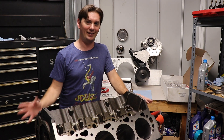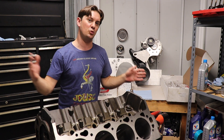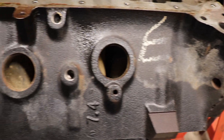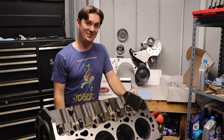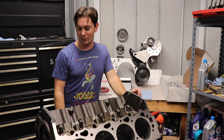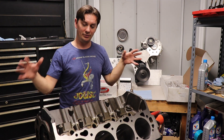I don't know what everyone pays for machining in other states, but California is an expensive labor area. For a basic machine job you're looking at about $800 to $1,200 depending on what you want done. You want to prep it before you drop it off — pull the freeze plugs, pull the pipe fittings, anything you can do yourself, because they charge for that. Unfortunately a bunch of mine were stuck and had to be destroyed and pulled out, which is like $10 or $12 per plug. After everything — new cam bearings, all the machine work, decking — I'm about $1,000 even into this deal.